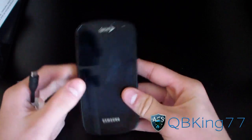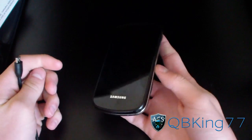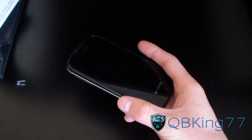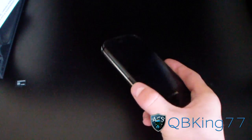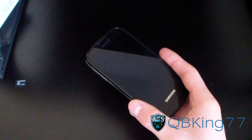You can also try it with the battery out — take the battery out, plug it in, then get into download mode. Try different USB cables and USB ports. Try reinstalling drivers. Those are the troubleshooting methods if you have problems with Odin.